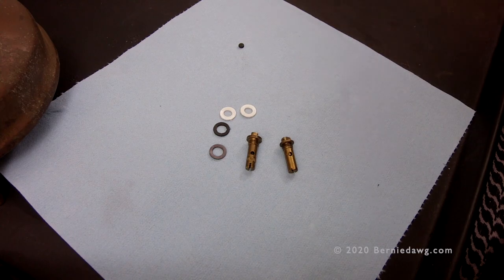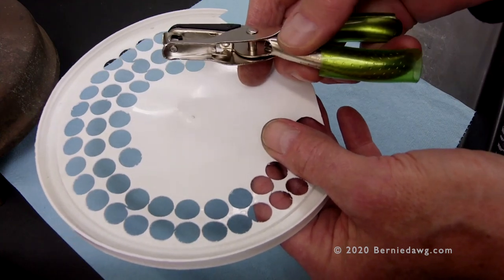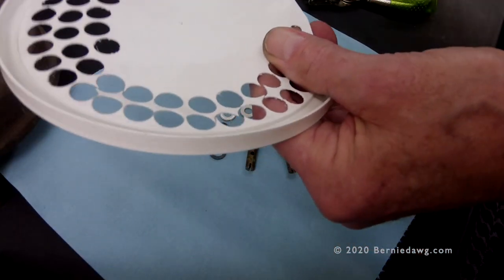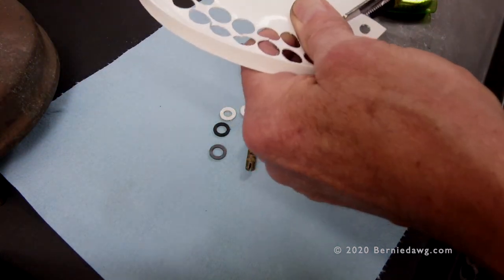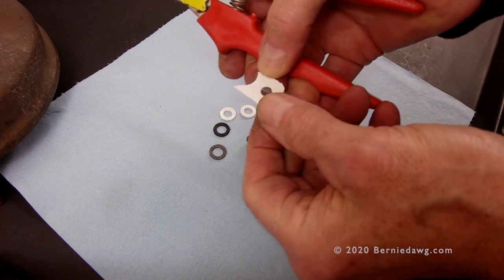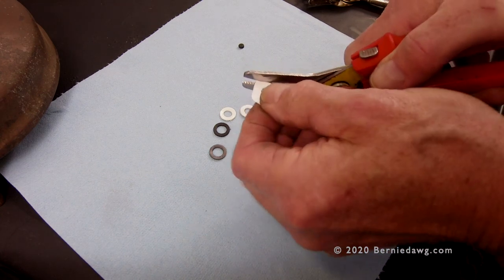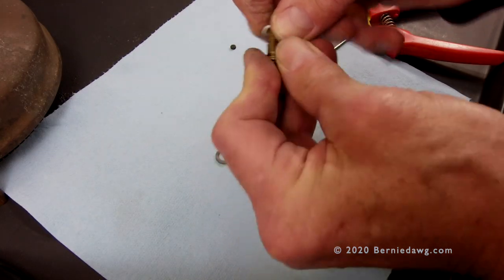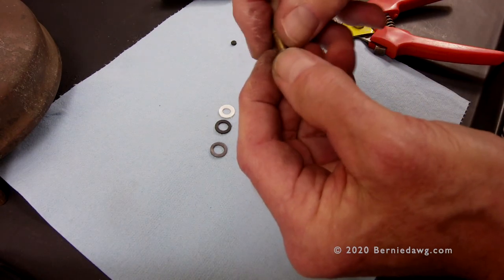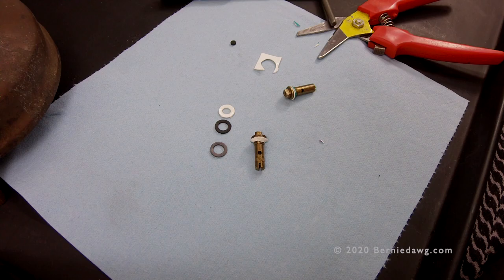For punching gaskets, I use concentric hollow punches, but those are expensive if you only have a few stoves. Instead, use a standard paper hole punch — the lids I use are marked number two recycling plastic, which is soft and waxy. Punch a hole to get a six millimeter or quarter inch diameter opening, then cut it out with scissors and trim it to about the size you need. It won't be as perfect as a concentric hollow punch, but with a little work you'll get close. Work the head gasket over the barrel and up into the threads of the NRV head; you can even use the NRV tool to help screw it on. When enough threads are showing, it'll seat properly when installed in the stove.